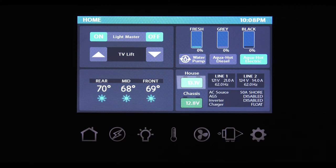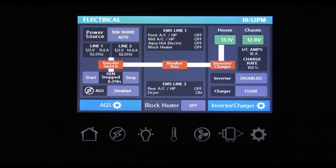The section to the bottom right is devoted to your coach's power. This shows the voltage of your house battery and the voltage of your chassis battery. These screens constantly monitor the AC power coming in from your transfer switch and inverter. You can also see your power source and modes for your auto gen startup, inverter, and charger. Pressing the electric hard button brings up a more in-depth look at your coach's power. At the top you can see your power source — here we are connected to 50 amp service. Right below is the display for your voltage, amperage draw, and frequency for each line. These numbers should match or be very close.